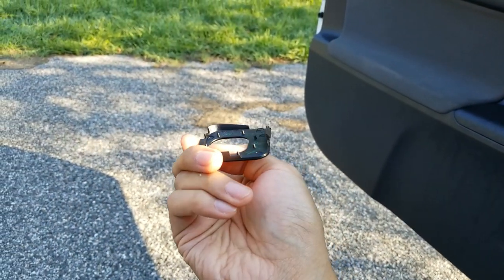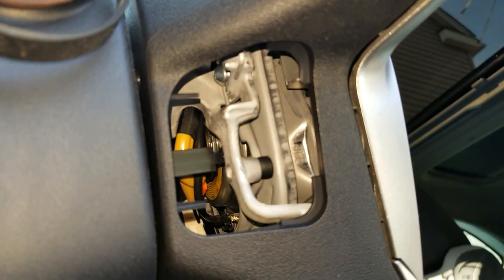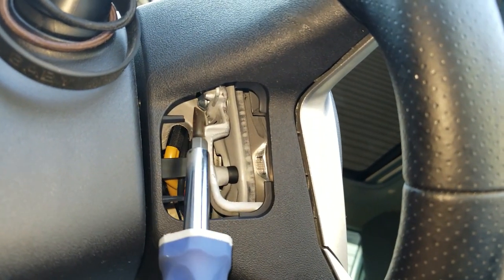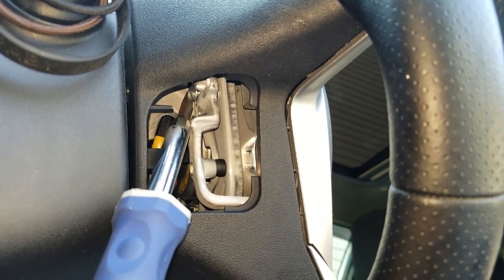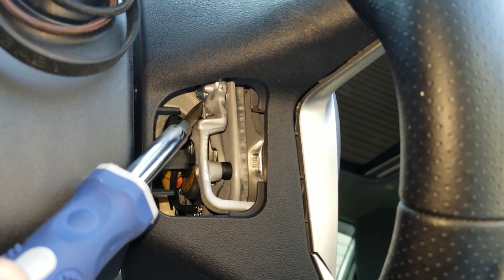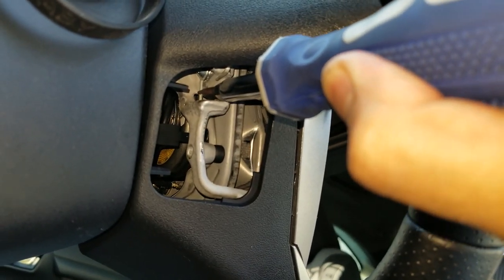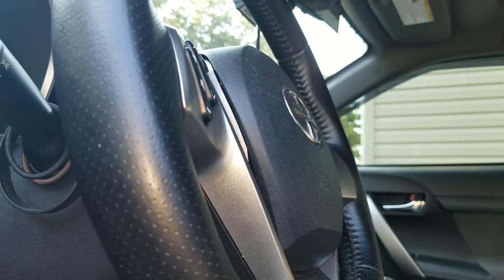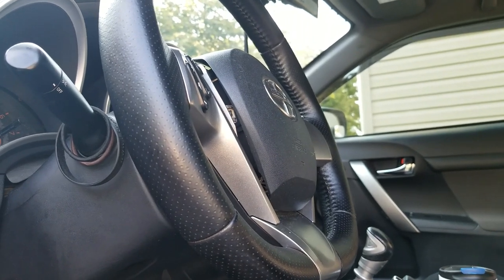Here's what it looks like on the backside to give you an idea. Now let me go ahead and show you how to get the airbag off. This is what you're going to see once you get that plastic piece off. If you look right here, this is the pin that's holding in the airbag and it's being held in place by this wire, which is actually a spring wire. All you need to do is take a flathead screwdriver, press the wire in this way, and the airbag will loosen on this side. Go ahead and do the other side and then the airbag should come off.